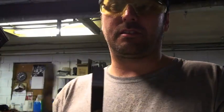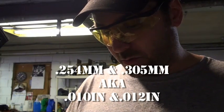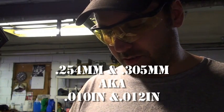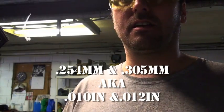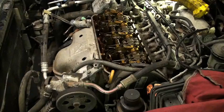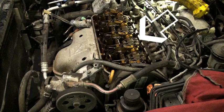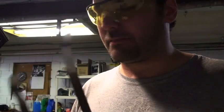This is the method that I use if you wish to attempt this. I showed you earlier where the sticker is on Hondas and Acuras for the thickness of the feeler gauge that you'll need. I have these ultra long ones and I've gotten used to using them. On this particular vehicle I use the 0.25mm and 0.30mm feeler gauges. The bigger one's always the exhaust and the other one is the intake. The exhaust valves are in the front because that's where the exhaust manifold is, and the intake valves are in the back because that's where the intake manifold is. Don't get them mixed up — they're both very different.